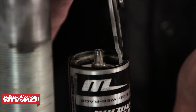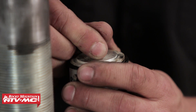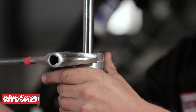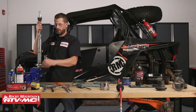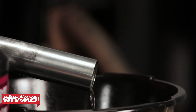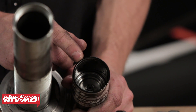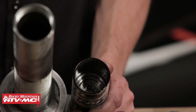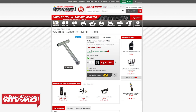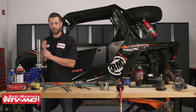Now we can take our snap ring pliers, place them into the reservoir at the base, get the snap ring pulled out, and then pull out the seal. Now that we've got this apart we can remove the seal head on the shock body. Once you've got that unthreaded, pull it up — you may want to wrap a rag around the shock body as it will lose some oil. Pull the shock body out of the vise and empty it into a drain pan. Inside the reservoir we have what's called the IFP — the internal floating piston. We'll need to pull this out using the IFP tool, which is absolutely necessary for this job and available at RockyMountainATVMC.com. Thread on the tool and slowly work out the IFP.